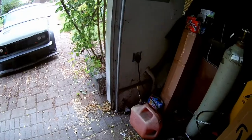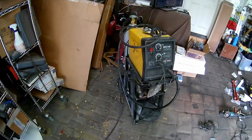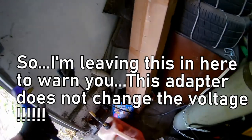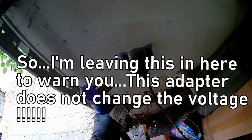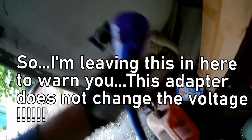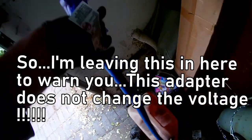First time I'm going to use this - it's kind of handy, but even with this little guy I'll blow the breaker in my garage if I'm up to max, which on some of this I probably will be. So when I got a TIG welder I wired in a 50-amp circuit and got myself a giant 220 extension cord along with that.